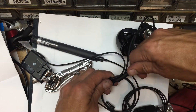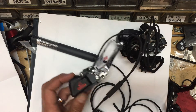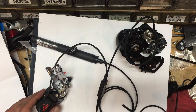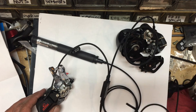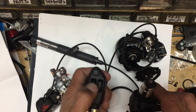Once you have these four plugged in, if you've got power in the battery you're powered up and ready to go. This is also a good practice for any new component group or one that's questionable — if somebody brings in a bunch of random parts, you'd want to just bench test it first before starting to route all the wires and everything.